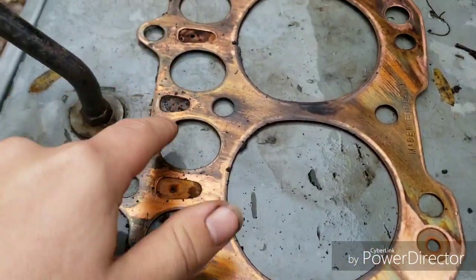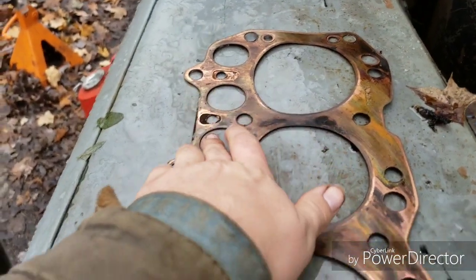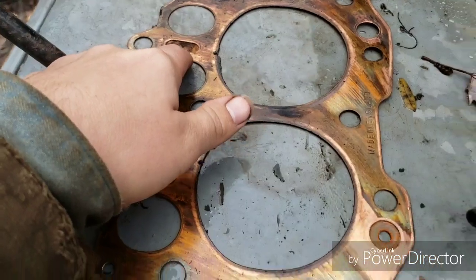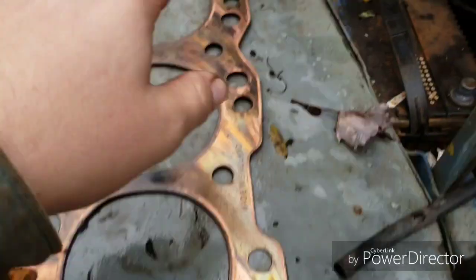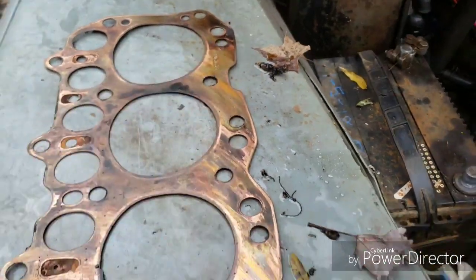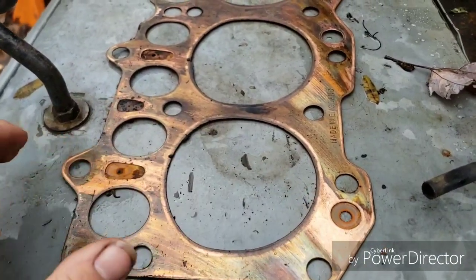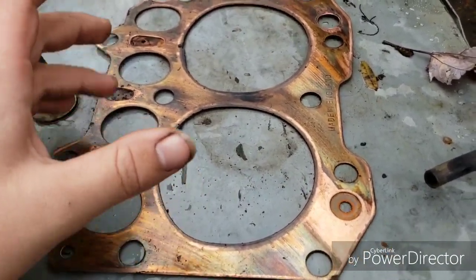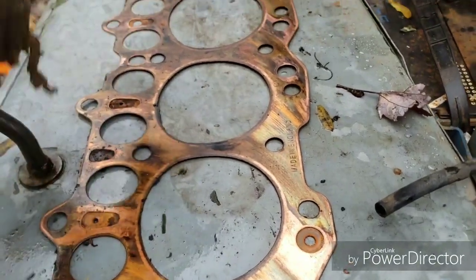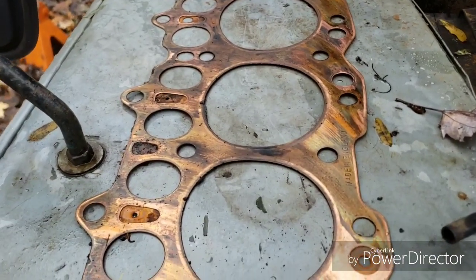If you look, these are all coolant passages. And the ones in the back here are opened up, and the ones in the front here are all kind of closed off. Same goes for that coolant passage versus that one. Yeah, that one. That's a head bolt hole. That one's restricted. What that does, well, when they made the castings for the engine, these all had to have cores in them, and in order to get the sand out, it's easier to make holes regularly along the whole thing. It's a lot easier than doing it asymmetrically.